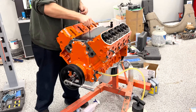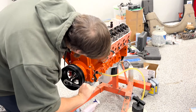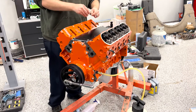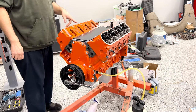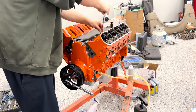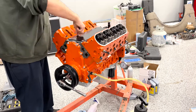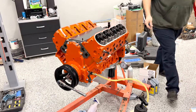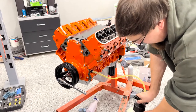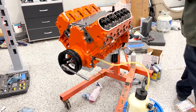It's different. This side, it looks like every rocker has oil in it now. So I'm just waiting on two more over here to come up. I'll do another 90 degree rotation. Sucker's sitting at 15 PSI on the block, so we should be good. I'll just give this a little bit more time to come up. We got oil coming up to this one now. Just got one more to go. Alright, so there's oil at every rocker arm now. On both sides, we got oil coming up, so I'm gonna go ahead and shut this down. Just loosen the lid and let the pressure out of the system here. Finish putting this top cover on.